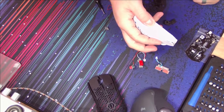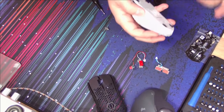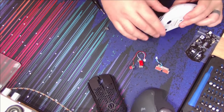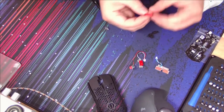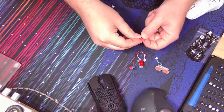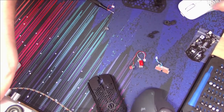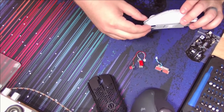So the amount of force that you have to depress with, there's much less travel. Obviously the force remains the same, because force is constant for the most part. What I'm saying is travel. So the more material you have, the more preloaded the switch is. For instance, I don't know if this is gonna come through or not, but when I press this switch, ooh, that's a hard angle to hit. There's a bit of travel where my thumb is pushing the plastic of the switch down, but it hasn't actuated. So when you preload that with those little acrylic pads, you can literally make it a hair trigger where there's no travel whatsoever.